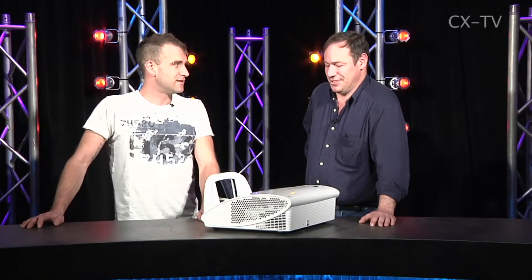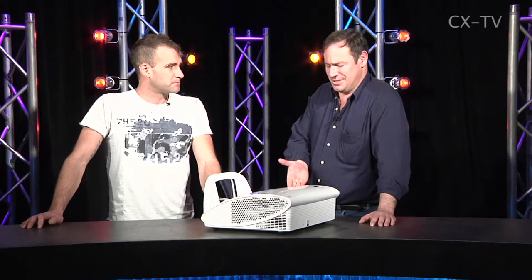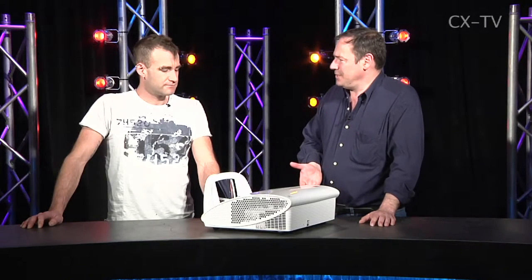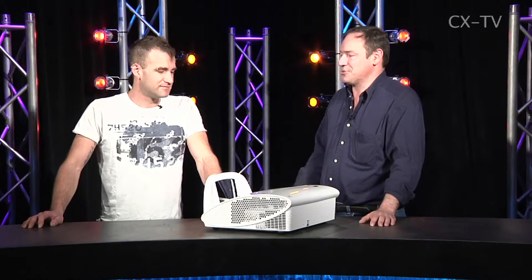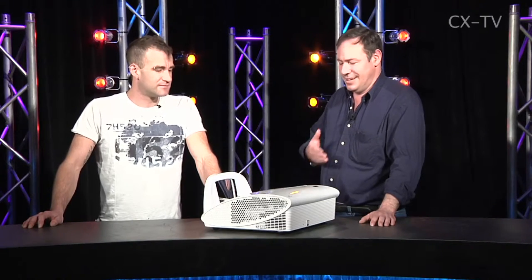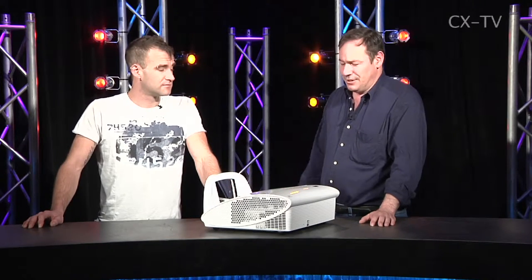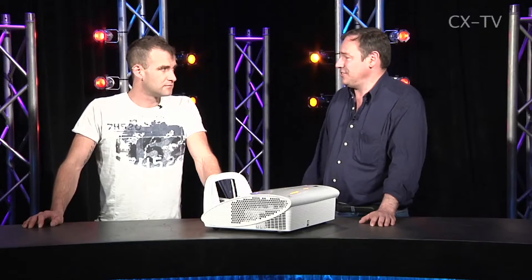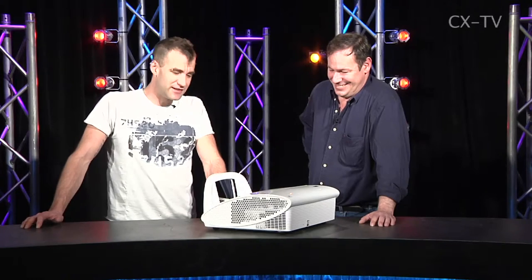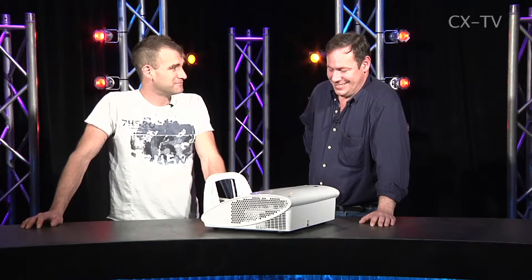A few years ago this is a 250-watt bulb producing 3,500 lumens — it used to be that you needed two bulbs to produce 3,500 ANSI lumens. It's getting more efficient and more affordable. The DLP technology rainbow effect is almost completely gone nowadays on single-chip technology, whereas a few years ago they were considered rainbow makers. So basically: brighter, better, smaller, cheaper. Amazing.